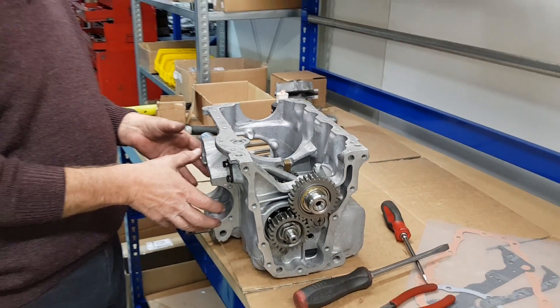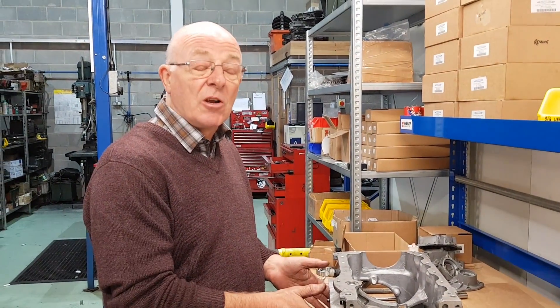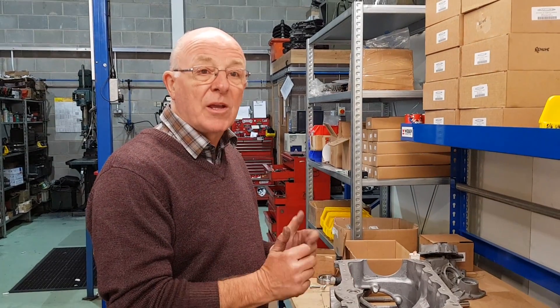So you've got the input gear, idler gear, primary gear on the crankshaft, then the drive comes down through the gearbox out through the pinion into the crown wheel, through the differential out to your wheels. Next week we'll go through building up and fitting the differential into the gearbox with shimming, and that'll be part three with the complete box.